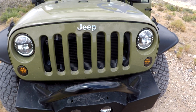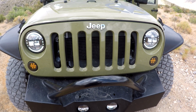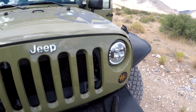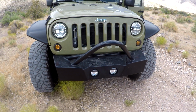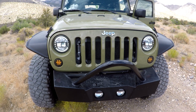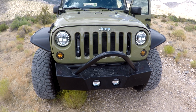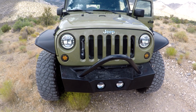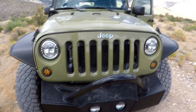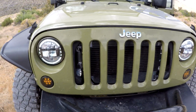Jeeps with hoops, you say, well, this doesn't do a whole lot of harm. But when I start going 75, 80 plus miles an hour, this hoop becomes important, because that airflow stream hitting us at 80 miles an hour is just shooting right up over the hood. And I just took a Jeep up to Park City that was running a little bit warm. Actually, it was running really warm. It wasn't overheating, but we'll talk about some of the reasons why. But the faster I went, the higher the fan speed went. And it really should be the opposite, or not increase speed, because the more air you cram through that radiator, the cooler it should run. But the reality was the hoop was causing it to fly up over the hood, and the fan worked harder and harder and harder until it couldn't work anymore.